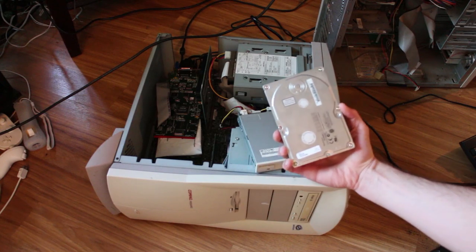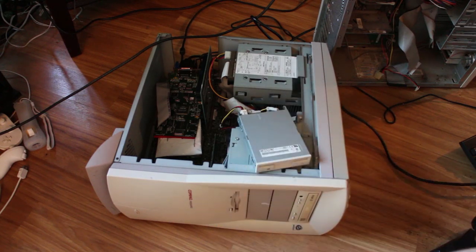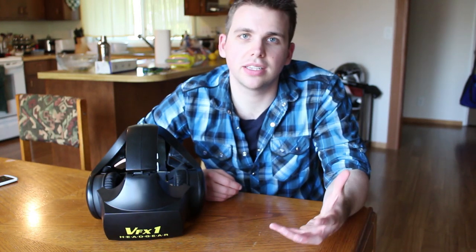We had several hard drives to use from. They were all IDE drives, but they were all much bigger than MS-DOS supports. And I think partially because of this, it had a really hard time partitioning the drive. So we'd load up the FDisk program, and it would allow us to delete the old partitions, but once the partition table was removed, it said there was no more space for any new partitions. This was really unfortunate because that meant we couldn't use the boot disk to partition on the drive. So we had to take the drive out, plug it into a different computer, run Linux on that computer, and then use the Linux version of FDisk to create the partitions, and then move the drive back into the other computer.